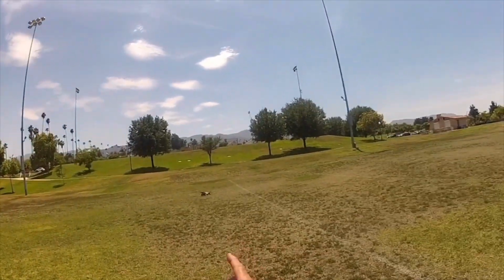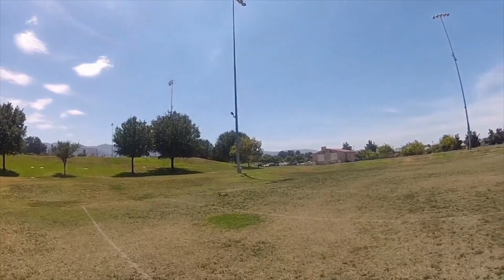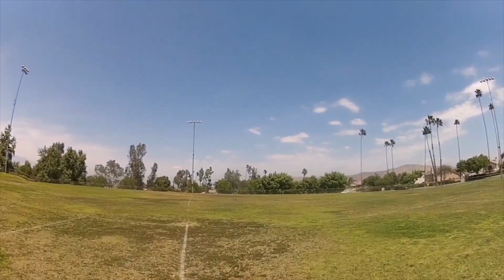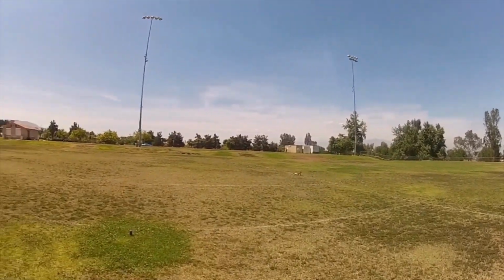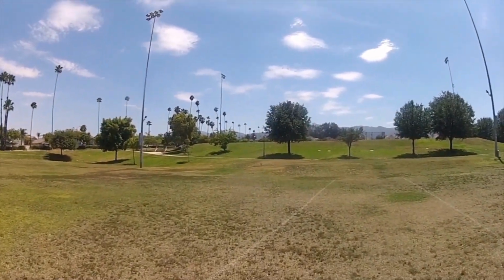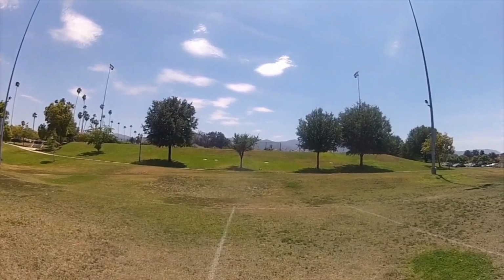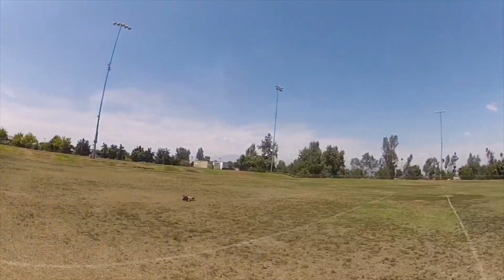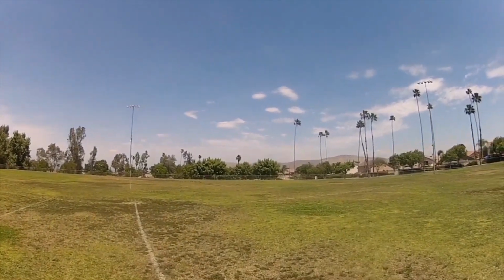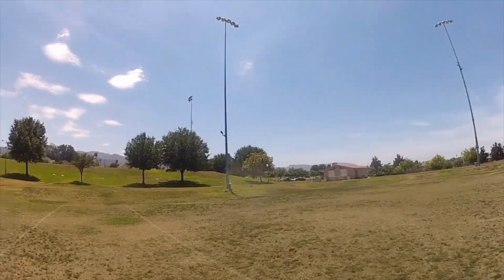So we're running the P3. This is the RB modded P3 Pico 0.28. It's got probably coming close to about 10 gallons now. Ton of pinch. I did about halfway, about 5 gallons. I put ceramic bearings in it. It has a new connecting rod, which Lance recommends after a break-in on Picos that you change the connecting rod, because they're so tight. I believe I'm running a 15 on this.